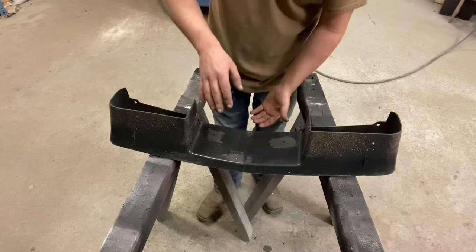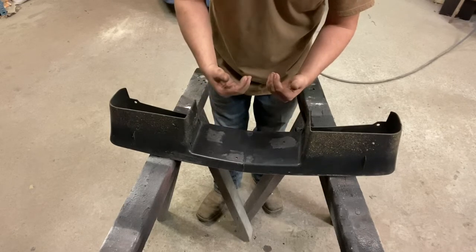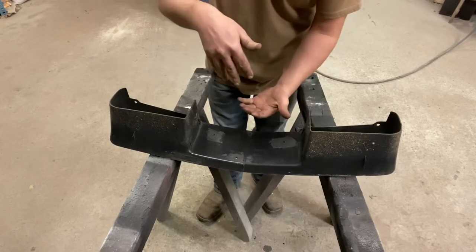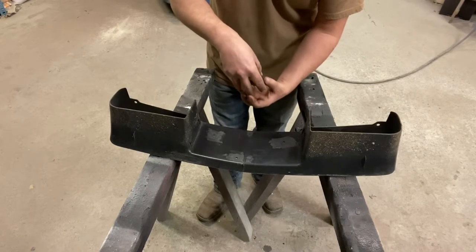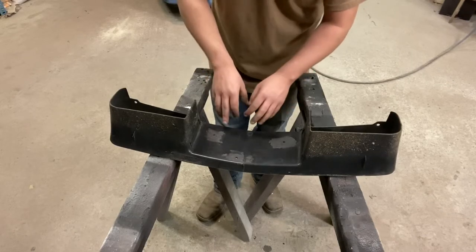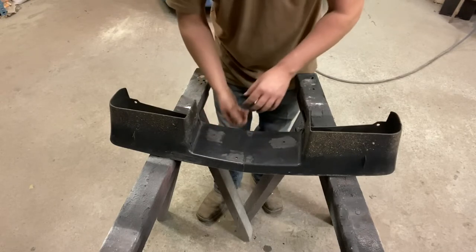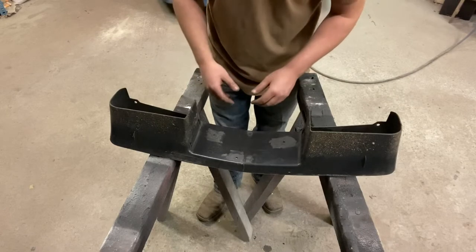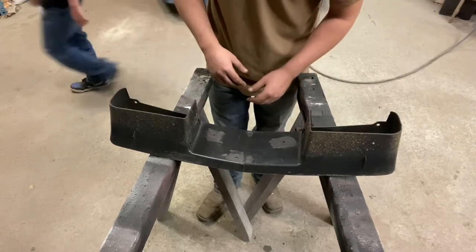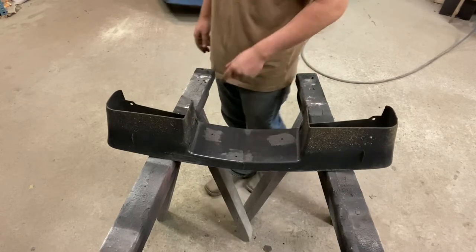And the idea is to get the fiberglass filler pushed down enough into these holes that whenever I go to the top side and I grind it back like this, then I'm actually into that filler to where then I can fill that top side as well. And the filler is through the hole, bonded to each other. I've never ever had anything like this come back on anything I've done when you do it that way, when you can actually get the filler to meet through both pieces or through the piece and bond to each other. I've never seen it fail that way. So that's how we're gonna do this one, just like I've done a ton of them. And after that, we'll be able to get it sanded down and do the fun stuff, the paint stuff. So let's get some glass on that.